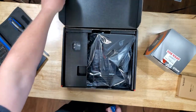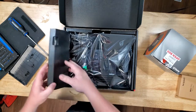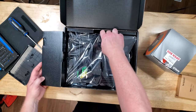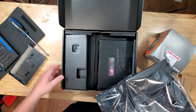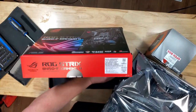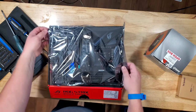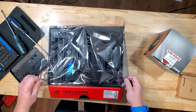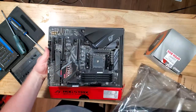I don't foresee any problems with this, so let's get going. Let's actually get the chip on the board and maybe get the board half put together before we bring the case back in. I went kind of bottom of the barrel for my last motherboard, so this should be a bit of an upgrade — definitely for power delivery and stuff like that. All right, let's just close this up and build on top of the box like you're supposed to. I almost forgot my strap. I got my strap on, plugged into my power supply — power supply's on. That way I'm de-staticed.